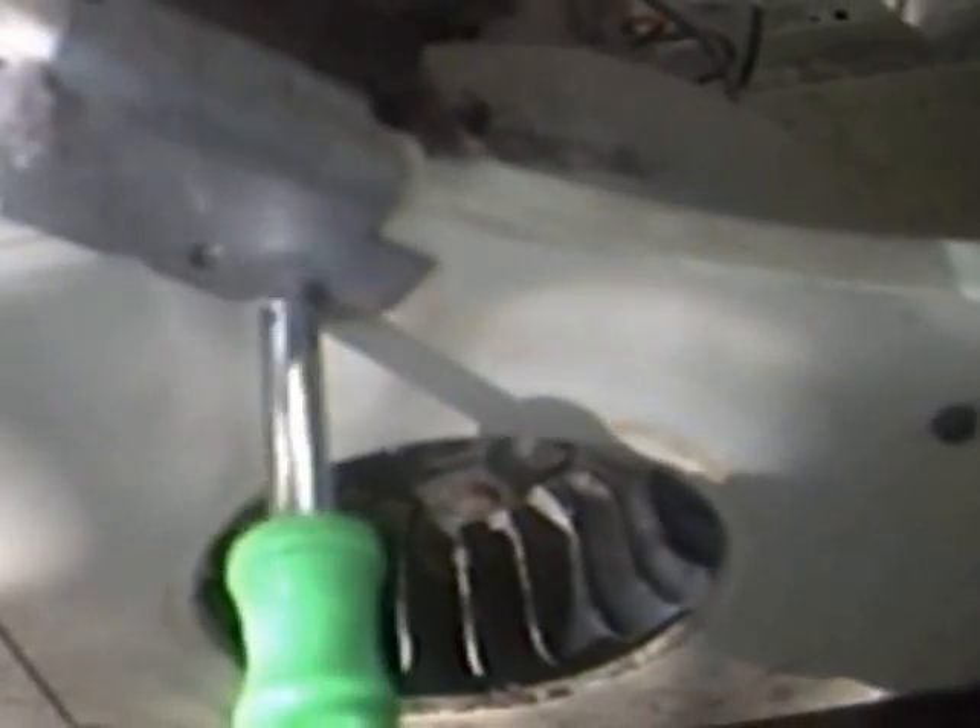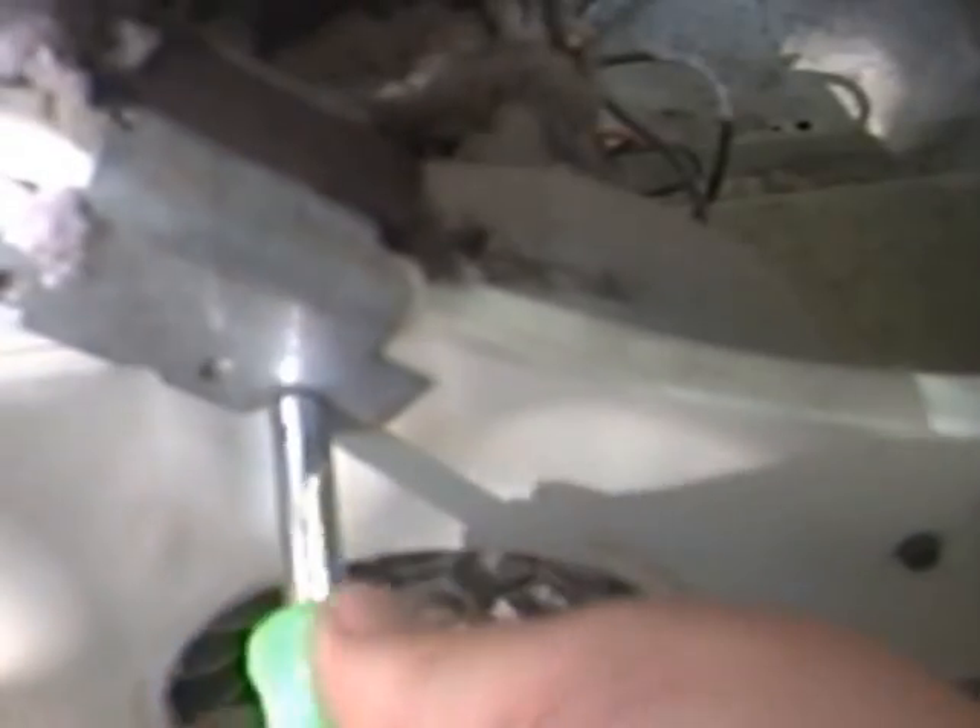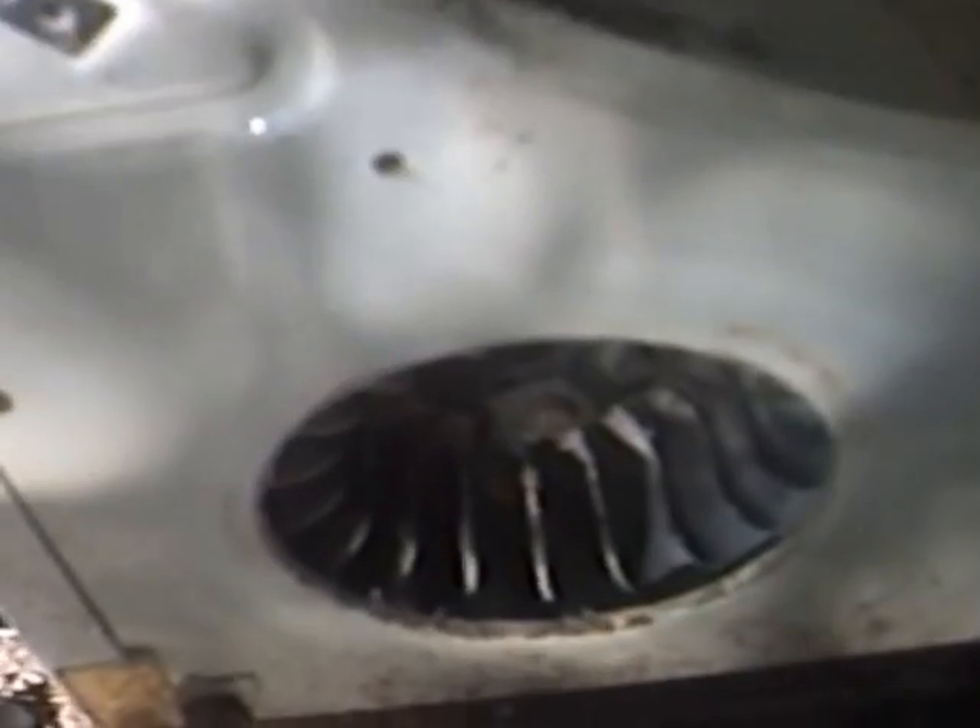It's not very hard to replace and I'm going to show you how to do it. I've already took one screw out. A little shaky pawpaw here. Nothing could be easier — just lift that old one off, set your new one in place, just like that. Another screw goes right here. See, that's what you call a drum glide — that's what the drum rides on on the front.